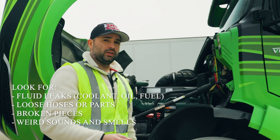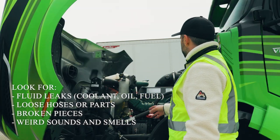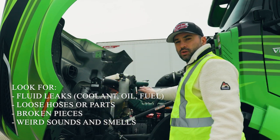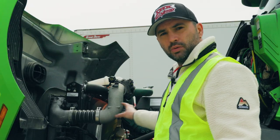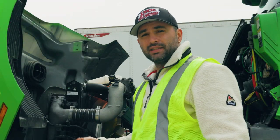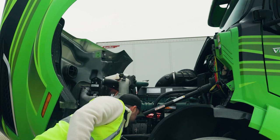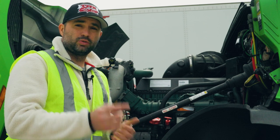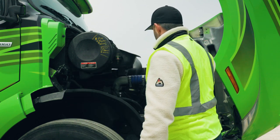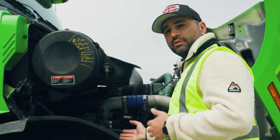You might be wondering what to look for once you pop the hood. You want to look for loose hoses, any leaks around the radiator fan, radiator, coolant levels, and your rubber hoses. Make sure you don't have any coolant leaking over your engine because if you have a coolant leak you will notice it. Typically you can also see where it's coming from, but that's not always the case. Listen and smell. Once you check one side, check your brakes and make sure nothing is wrong. Then go to the other side and do the same — check coolant level and look for any oil or coolant leaks.